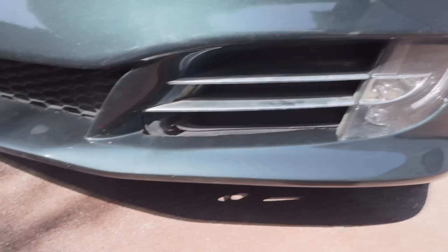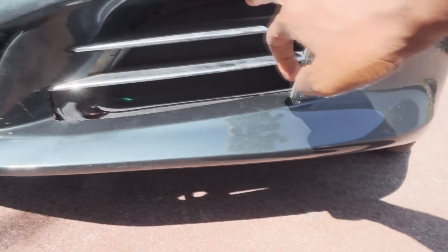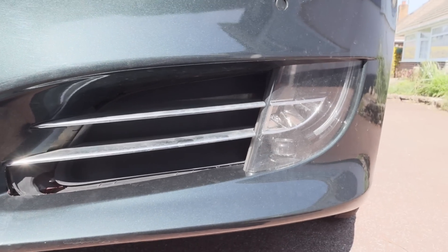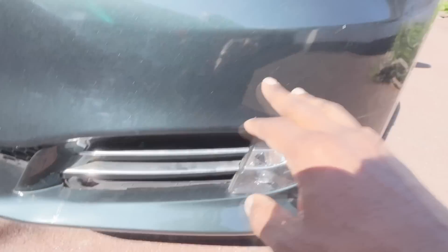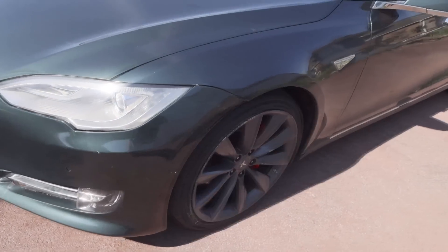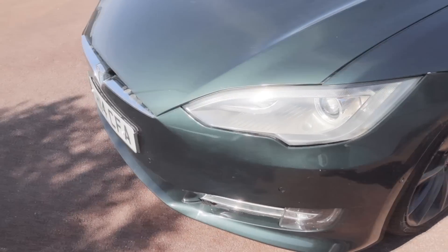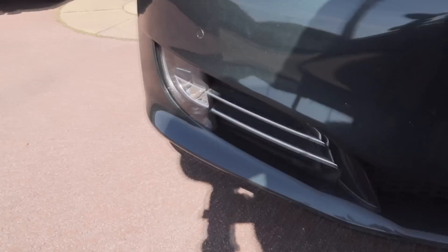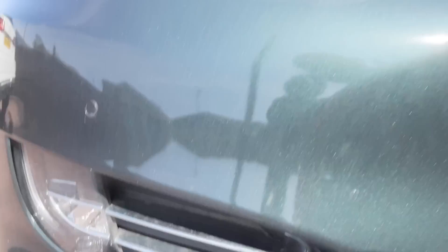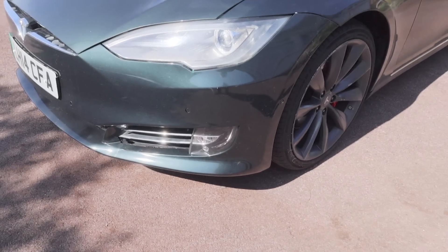Here at the front of the car — this is the vane we're talking about. At the moment it is trying to open on this side but it clearly isn't opening, so we need to investigate why. To do that we'll take the bumper off, get it up on stands, and give it an inspection. This side here works absolutely fine, no problem, but the other side is reporting back the problem. Let's get that to pieces and see what's going on.